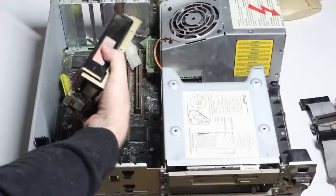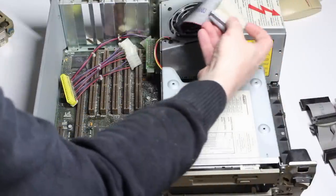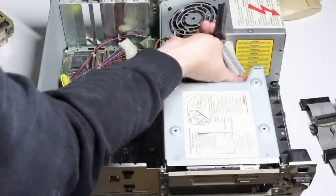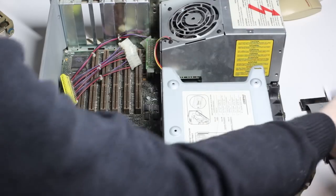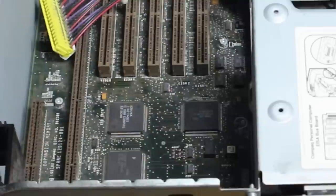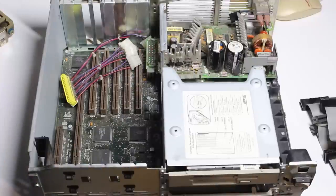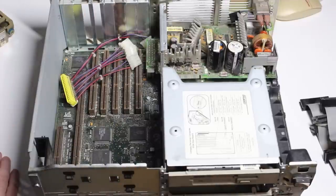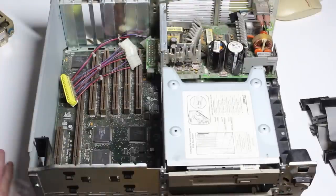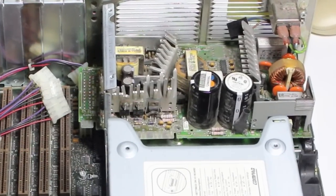There's actually a floppy drive in the machine, and hopefully that's the correct one. There's no hard drive, but I have a drive that was used in a Compaq 386 — and the connector has an ordinary IDE connector on it anyway; it's only the other end that plugs into the mainboard that has the proprietary Compaq connector. The other problems: there's no CPU. There's a CPU slot and also an expansion memory slot — and I guess you can probably figure out what that mystery card is now. The power supply is also a concern, as it was open when I purchased it.